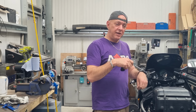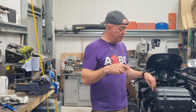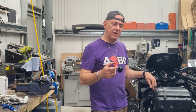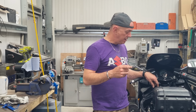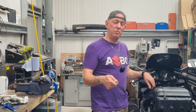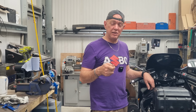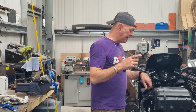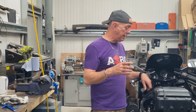Then we switched over HT leads. So the lead that was on number 2 is now on number 3 and vice versa, but 3 then got hot. So it's like, okay, I doubt it's the coil then. I doubt it's the lead either. Then we had it running, and whilst it's running, we pulled the HT leads off one at a time. You pull off the one on cylinder 3, and there is a marked horribleness that starts happening. It barely kept running, but it was running like an absolute pig.